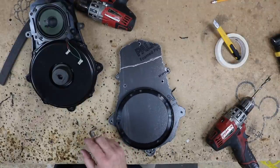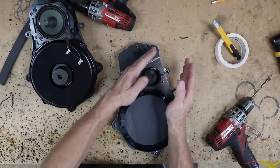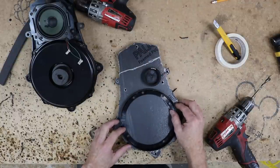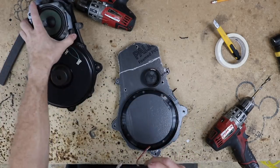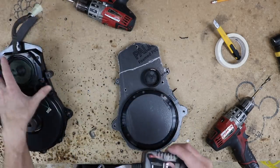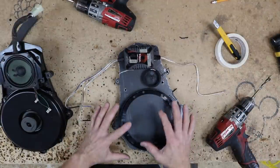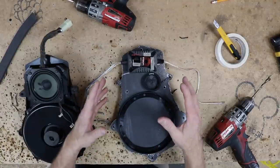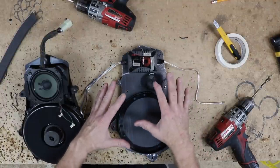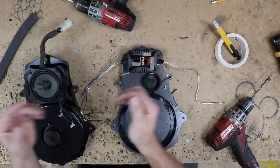We're gonna mount our new tweeter up high here like this, so it's in the furthest most corner of the door panel. And then we have these crossovers here, just like this guy right here. So this giant piece that's here, we can now mount our crossovers just like this onto this, emulating this whole guy right here. So this is gonna allow us to get our new speakers in, keep this nice and dry, well mounted towards the front of the door, not the back of the door.